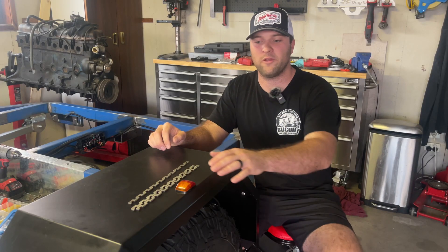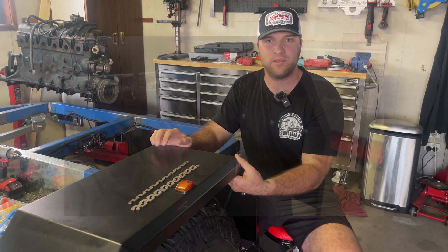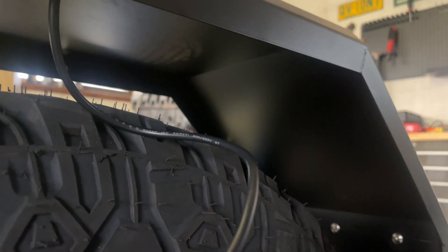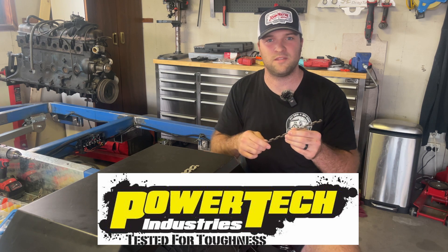What we're going to do first is run the wiring from our clearance lights back to our junction box. The best spot for that is going to be underneath the crease inside the guard, because the tire can't actually reach that spot, so that's going to be a safer spot for our wiring to run. The way we're going to do that is use our trusty weld-on zip tie mounts, made by a company called Powertech Industries — they're the sponsor of today's video, so a big thank you to them.